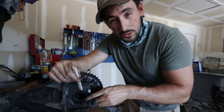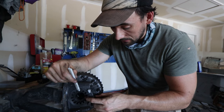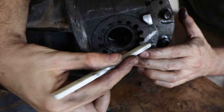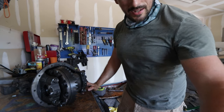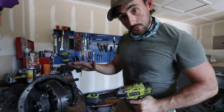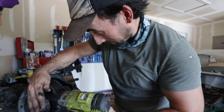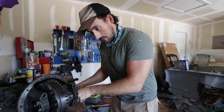We're going to be setting backlash to make sure it's on there right anyway, but this could just make reassembly easier, especially if we're just going to end up slapping it back together. It depends on what we find in here. Now we're going to take the big end caps and pop those suckers off — I need to make sure I know which side goes where, and we'll put them down on the cardboard with everything else.